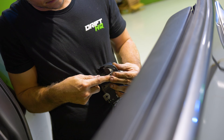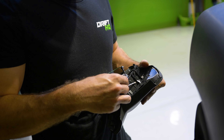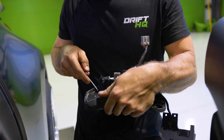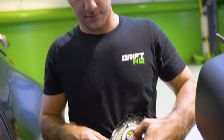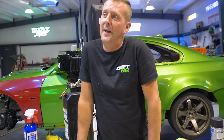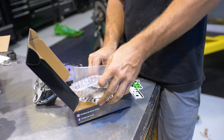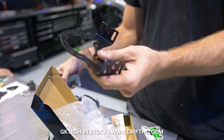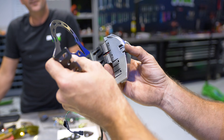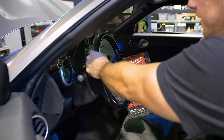We are retaining the steering wheel buttons. We've got a sweet little thing from GK Tech that gives you a mount that attaches these buttons onto the hub, so you can still have your radio controls. This little adapter goes right onto your hub adapter and then this just bolts right up to it, so you still keep those controls right between the spokes of your steering wheel — but it has to go in front of the quick release, otherwise you can't quick release the wheel.